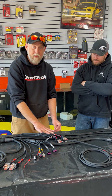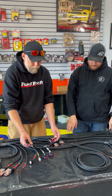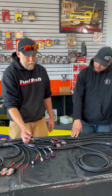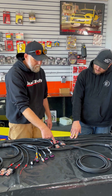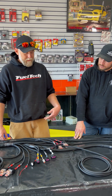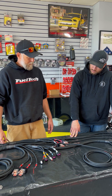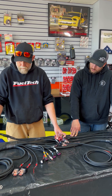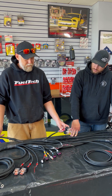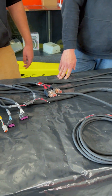This is your trigger wire for the relays. FuelTech suggests using an output from the ECU to trigger this so that the coils don't rest with power on them all the time. Basically, use a yellow output as an RPM trigger at 100 RPM — that will light the coils up to give spark once it's actually trying to start, instead of the coils resting with power all the time. Otherwise, hooking up the smart coil harness — you get one wire on your end, the battery terminations, and a bulkhead.